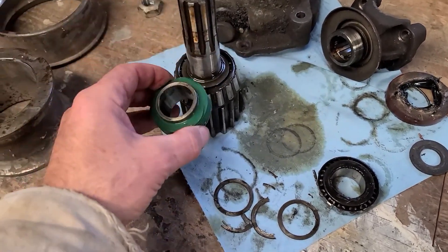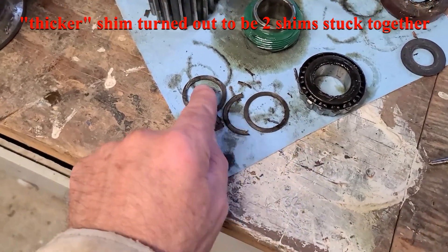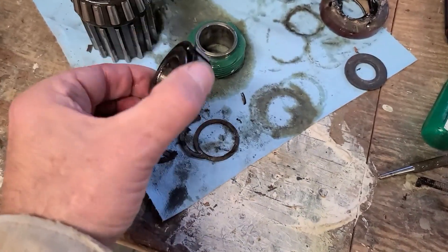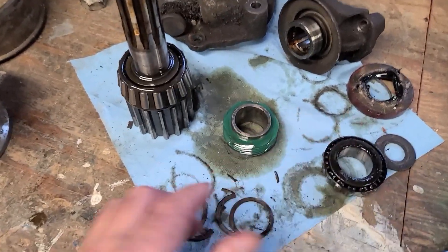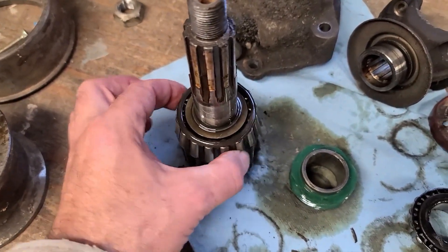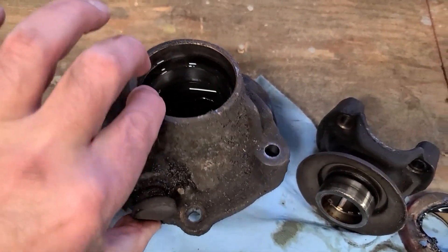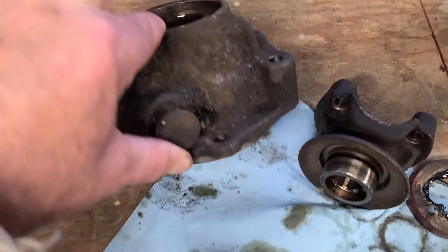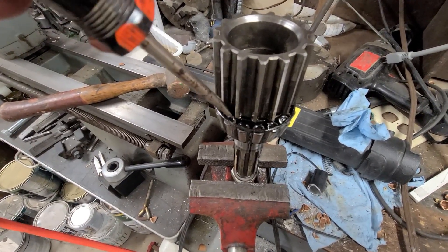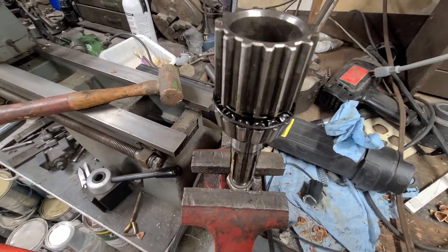The speedometer gear just pulls straight up off the shaft with no problems. The shims that were on top included a thicker one, a thinner one, and one that was disintegrating. The outboard bearing was on top of all that and just slides out. Now I need to tap the inner bearing off the shaft, and also tap out the bearing races from each side of the housing. A press is always best, but I was able to pop the bearing off by alternately tapping each side of it while in the vise, scooting the inner bearing on down.